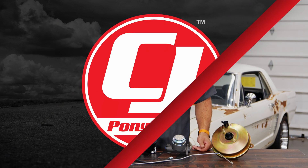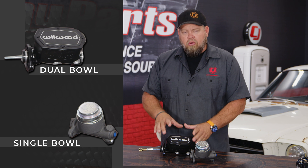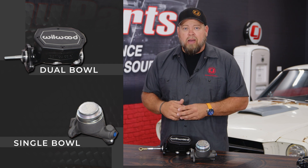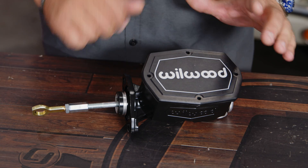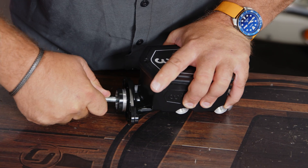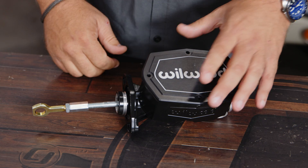Let's start with the master cylinder. In front of me here, I have two master cylinders — an old-school single bore and a more modern dual bore. We're going to discuss the dual bore first and go back to the single bore in a second. We're going to give you a close-up of the dual bore and how it actually operates. This linkage here is connected to a piston inside the master cylinder itself. This is connected to the pedal. Through the cantilever effect, when you push the pedal, this will actually push in and push a piston inside the master cylinder.